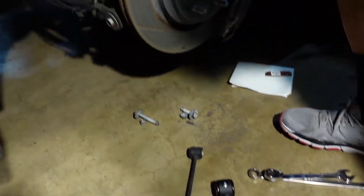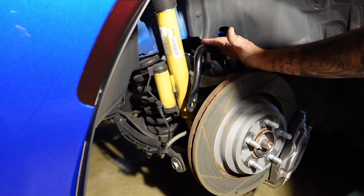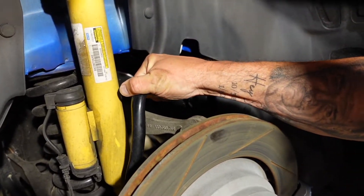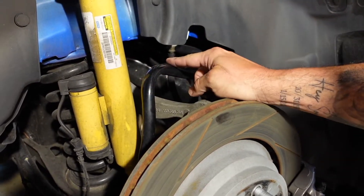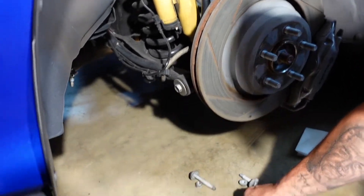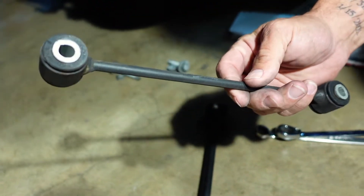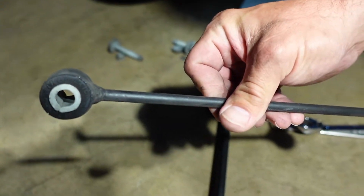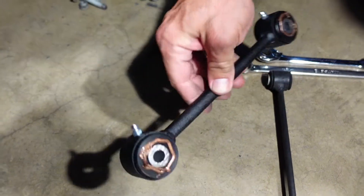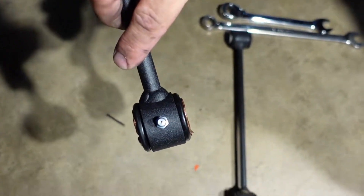When you take the factory wheel off, you're going to be going to either a 17 or a 15-inch wheel conversion so you can run your drag pack. We chose the 17 — I didn't want to do the brake conversion. What we're doing is repositioning the sway bar down so that when the wheel is on, the wheel does not hit it — that's the whole reason for putting the B Woody sway bar end links on. They're shorter, they're beefier. The factory end links are pretty cheesy — the rubber bushing is already cracked on this 2019 Dodge Charger Hellcat. B Woody did a nice job with a steel insert, Energy Suspension bushings, and zerk fittings so you can grease each end.